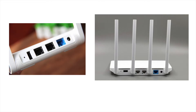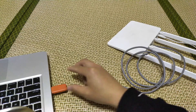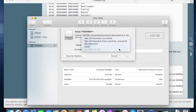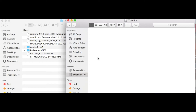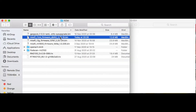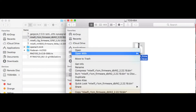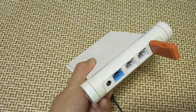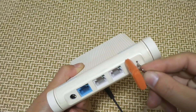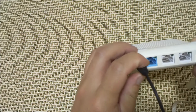The Mini Router, the WiFi 3 Router, and the 3G Router have USB ports. To revert to stock firmware, we need to use a USB drive. Format the USB drive to FAT32, download the relevant stock firmware, put it into the USB drive and rename it to MiWiFi.bin. Then plug the USB drive into the router and put it into recovery mode. It will search for the stock firmware from the USB drive, and if nothing goes wrong, it will write the firmware into the flash storage.